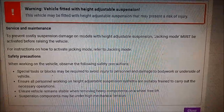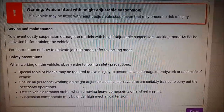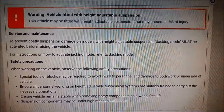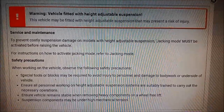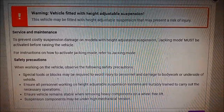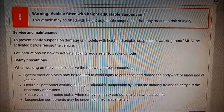On these particular transmissions or vehicles — the Land Rover Discoveries — they have what's called a jacking mode. If you start jacking or lifting things, you might find that the whole vehicle lowers itself down onto you, and it can crush you or damage your equipment. So please be aware of that and make sure you do any repairs or inspections safely.